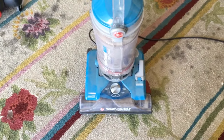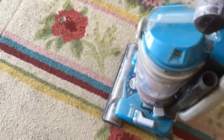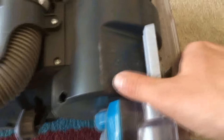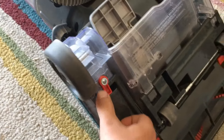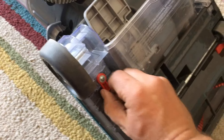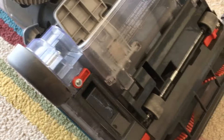This is one of the main reasons it can cause that. The first thing you want to do, obviously, is unplug your machine, flip it over onto its side, and lean it back like that. On some of these — this one's actually easier to do than any other normal Hoover — pull these tabs back and this one up here, lift all those back, and pull your skid plate off.